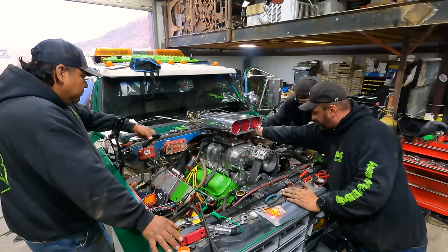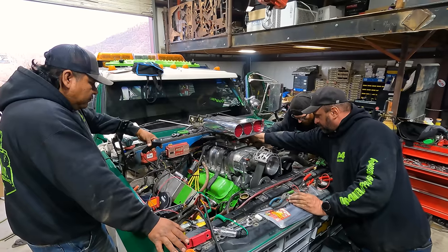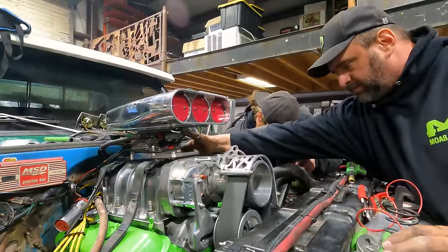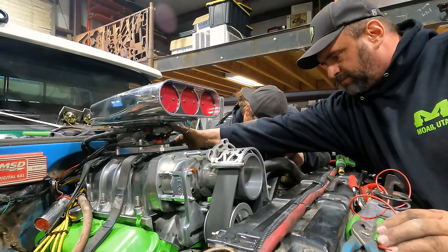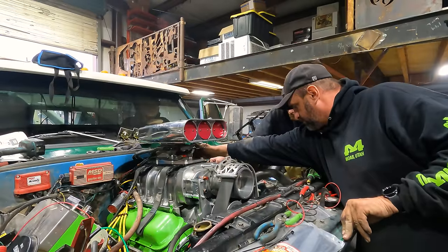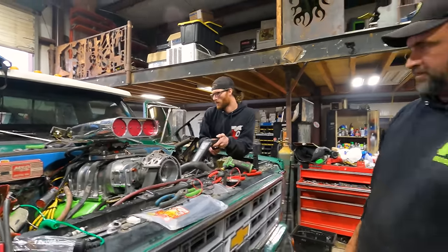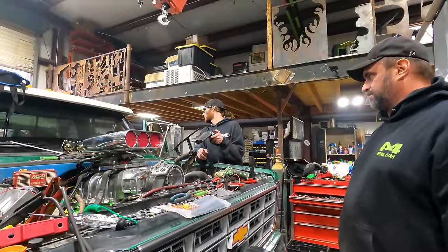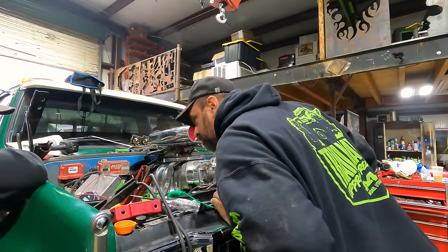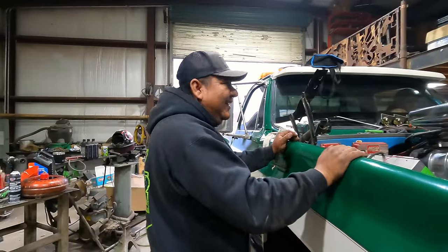Okay, hold up. Go ahead, Sean. At the end there was about 15 vacuum. The highest the boost ever was zero. Well, that's good — that means we need RPM to build boost. That's what we want. Let's lock the distributor there. Hit the button. There you go. Gotta hit the button — Sean is all excited about that. He loves that button.